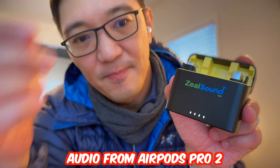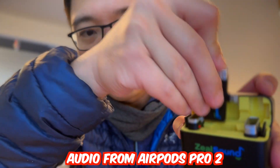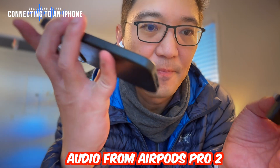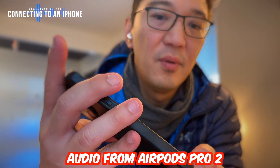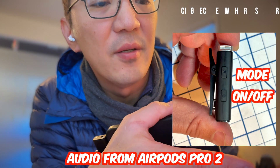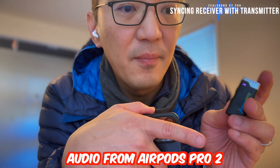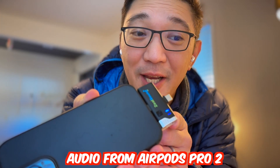This one is fully charged. So with the phone like this, you simply take the receiver and plug it in — this should go into the phone. Then you take the other side and turn it on. There are two buttons on this side: the on button and the control button. You want to push the bottom one, which is the on button. It'll start blinking, and when it's synced — there you go — the audio is now connected to the microphone.